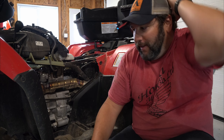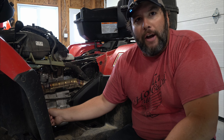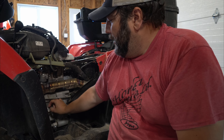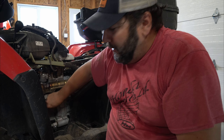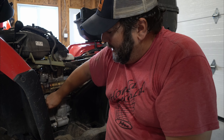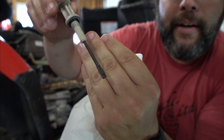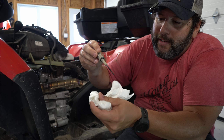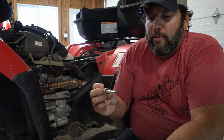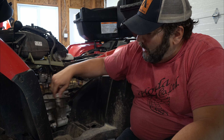Our two minutes is up. We're going to shut off the machine and then wait two minutes to check your oil — I'll show you why. I'll pull the dipstick right away as soon as we turn it off. Immediately pull the dipstick back to see what happens — you wipe it away, put your dipstick in without screwing it in and come back out — because we haven't waited the two minutes — and the oil is barely on it, it's like it's on the bottom notch. It drove me nuts the first time. I went to the dealer and asked how they checked the oil after an oil change and they said they didn't — they just fill it with 3.8 litres and walk away. There's an actual oil check procedure on these machines — you have to follow it to get a good reading.